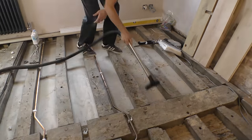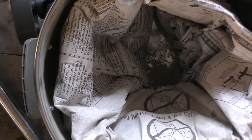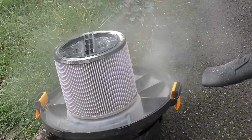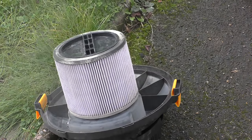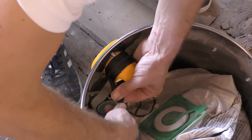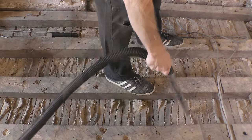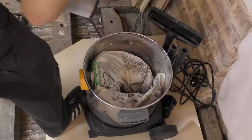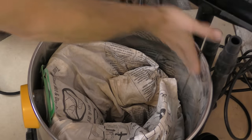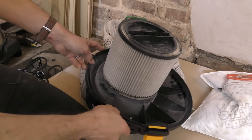I continue to vacuum and get three-quarters of the room done still on the same initial bag, which is pretty impressive. However, a look inside the drum at this point shows the dust build-up outside the bag is more than ever. So I've decided to do my own modification - I take the air filter outside, give it a really good clean with my Ryobi leaf blower, and then apply self-amalgamating tape around the tube inlet nozzle so that when I push the bag back on I've got a much tighter seal. I then continue to vacuum the rest of the room. A quick look inside the vacuum now - we don't have anywhere near as much dust on the air filter.